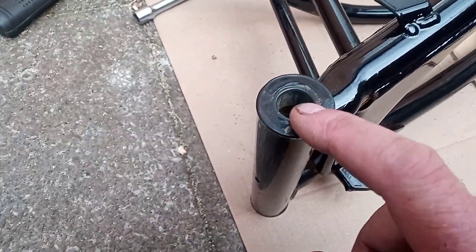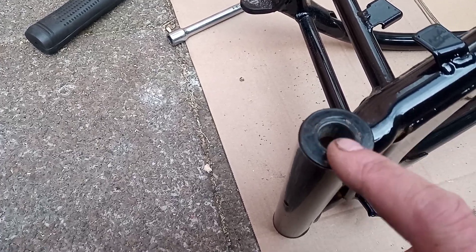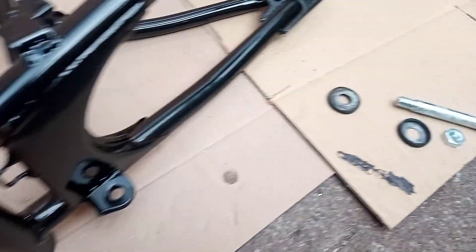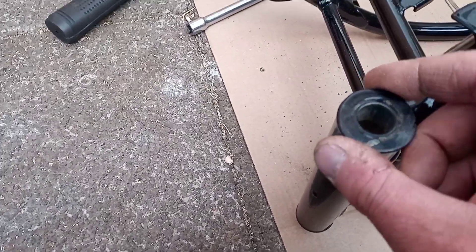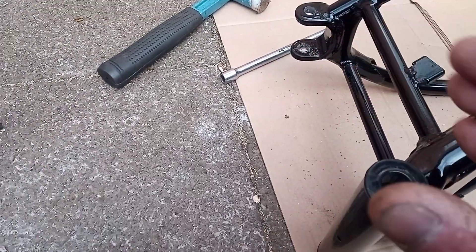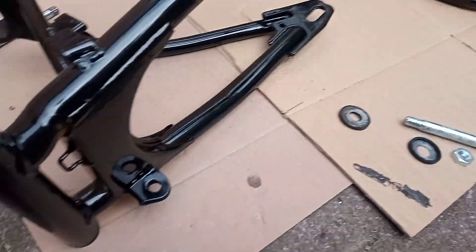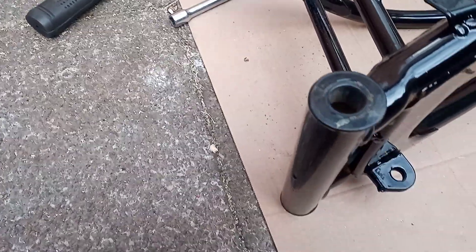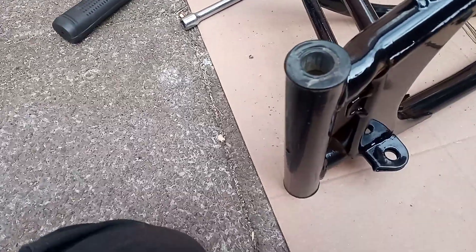The sad thing about it is, when it's been powder coated, the centre pin — that long tube that goes through the middle — when you put the bolts into the frame and tighten it up, it just pinches that shaft. So the rest of it turns on your suspension. I can't assemble it like this because if I bolt it up, it's just going to be solid and not move. That tube should actually turn in this part of the swing arm for the suspension to work properly.